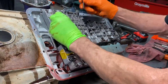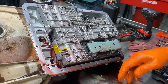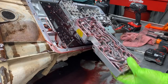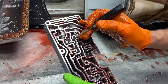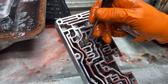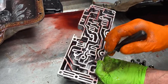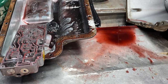So we can go ahead and pull these up. All these bolts on the bottom are the same length. Once you get up here you got longer ones and some shorter ones. Now this here is what you call your accumulator body - this is what we call a two stage. You have an accumulator valve here, your first stage, and then once this opens up it lets fluid get into another valve here that has springs down in here. It's a really big piston. When you put a Transgo kit in there, it'll have you change the springs out for your overdrive, your third gear shift, your intermediate shift. But that is a two stage system.